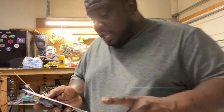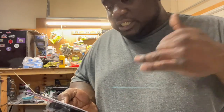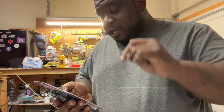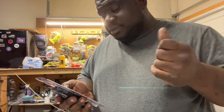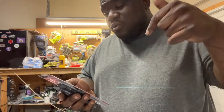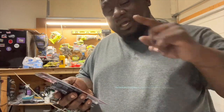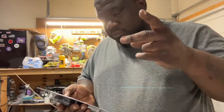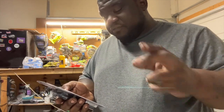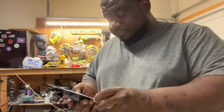So, green light means good. No water in the brake fluid. Green and a yellow, less than 1% content in brake fluid. Green and 2 yellows is 2% water in the brake fluid. Green, 2 yellows, and a red is about 3% water content in the brake fluid, and the brake fluid should be changed. Green, 2 yellows, and 2 reds, at least 4%, and brake fluid may be changed immediately.